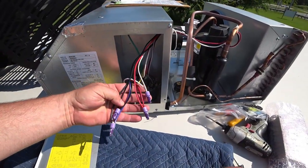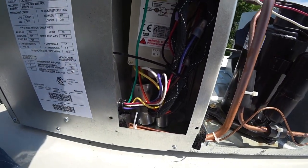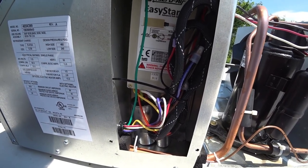You want a small generator but you want to run your rooftop air conditioner. That's where I did a Micro Air Easy Start install — I've got Micro Air units in each air conditioner up top. Even though I don't need them in both, it's nice because we can choose which one we use. The benefits of a smaller generator are: less gas, smaller footprint, lighter to carry, easier to store, mount, and protect from the elements. However, it's also easier to steal, so you still need to secure it.